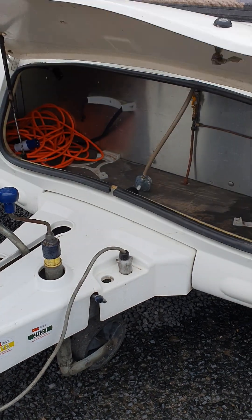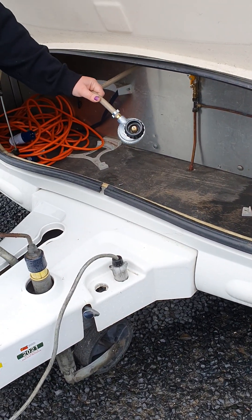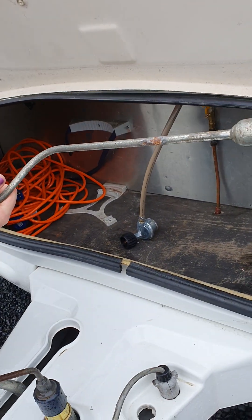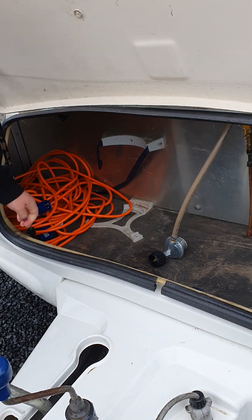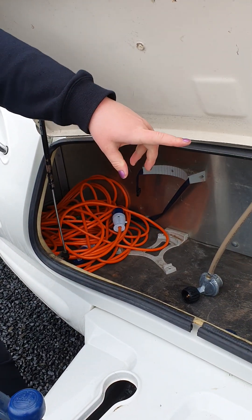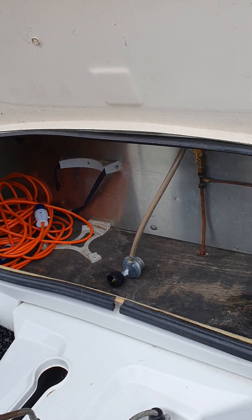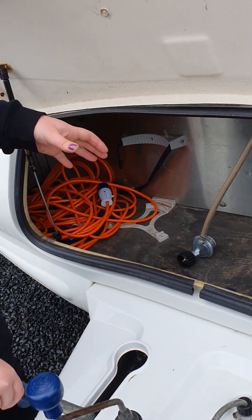Just behind your A-frame is your front locker. There is space in here for two 9-kilo gas bottles, and they have a standard spin-on barbecue connection. This is for the gas line — it's currently open but there is the option to shut it off. This is your leg winder; there are four stabilizers on each corner of the van and you use this to wind them up and down. These lockers are open to the elements, so don't store anything you don't want getting damp or dusty. The front lockers have a payload of around 20 to 23 kilos, so once you've got your gas bottles in, just store light bits and pieces — don't overload the front as it will affect the towing of your van.